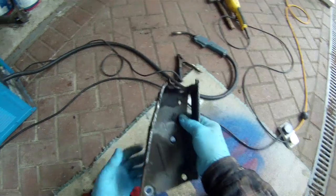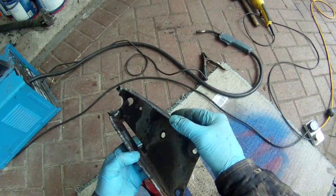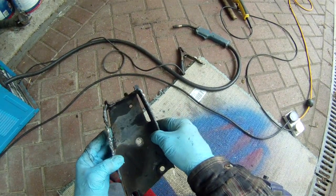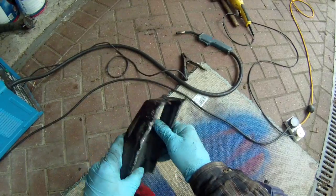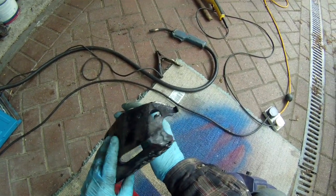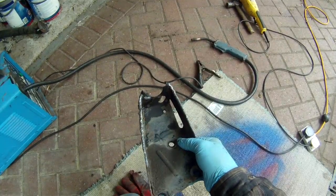It's on an MG ZS. Quite a common thing to go wrong. A lot of people try improving it by changing the whole clutch system, like that Sheddist clutch that I've seen, which is an all metal one. Nothing wrong with the system, but most of the time it's just this bracket that is the problem. It's a lot cheaper and easier way to fix it.